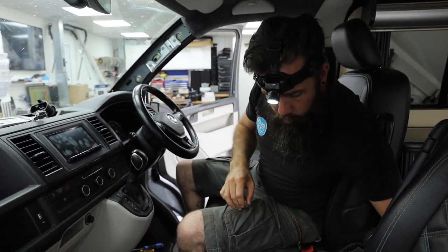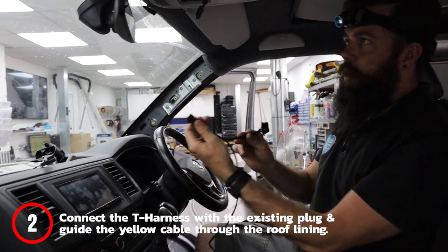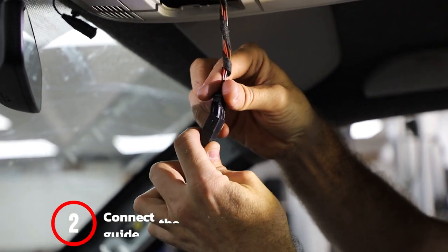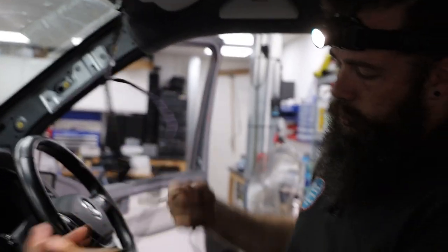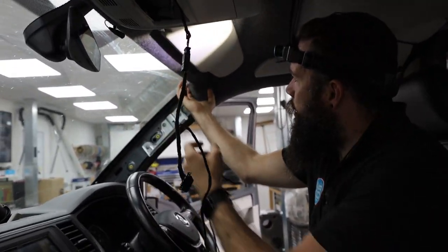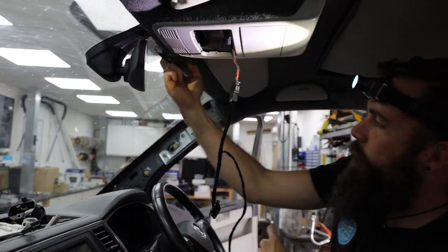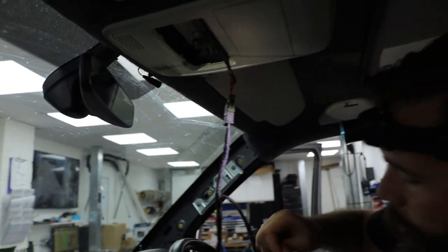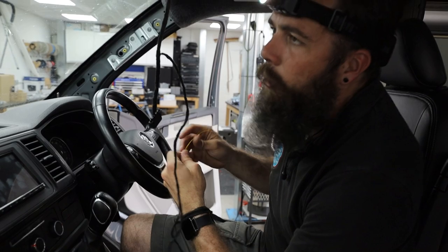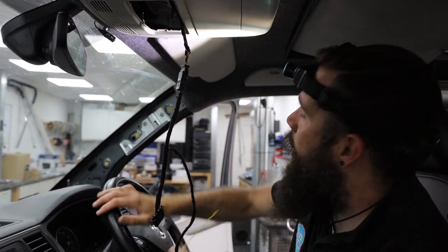With the new loom for the new light, it's basically a T-harness job. Take the factory original plug and plug it in — make sure you get a nice click so you know it's seated. This plug then goes into your new interior light. Before doing that, carefully tweak down the roof lining slightly — since it's been off before it'll have a little movement. Use a head torch to see through the gap, then poke the cable through, grab it with your fingers, or use a cable tie or coat hanger taped to the cable to guide it through.